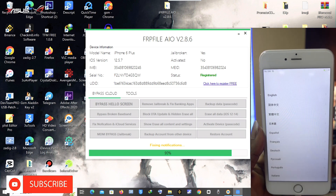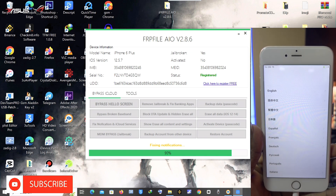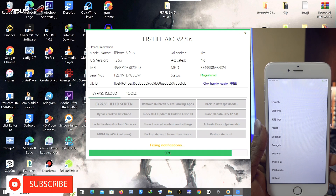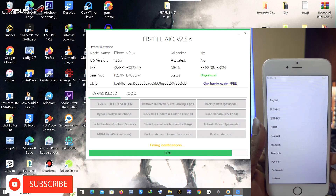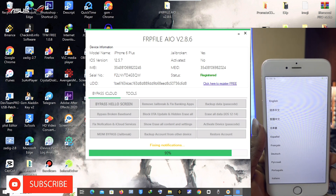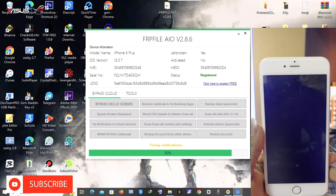For some reasons it will get stuck at 90 percent. I don't know what the problem may be — it might be some misconfiguration error between the device and the tool. I've encountered this problem with two different devices. Don't panic. If you wait and see that the progress bar doesn't move from 90 to maybe 91 or 92, you have to reboot the device, and once you reboot it will automatically skip the setup to the home screen.